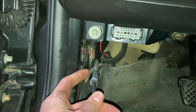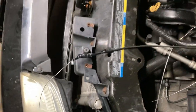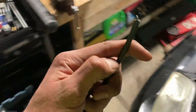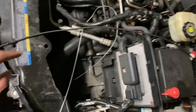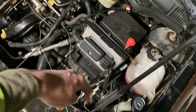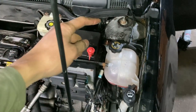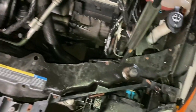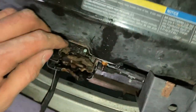The hole in the firewall has a rubber grommet — I did manage to pull it out, and this is the old one right here. The new cable does come with a new grommet, and it's facing the correct direction. Update: I managed to get the cable through the firewall. I ended up removing the plastic or rubber hose and just used the bare cable itself since it's very thin, and I got it through the wall. Now I'm going to snake it through the way the original one was — over here behind the headlights and into its position.